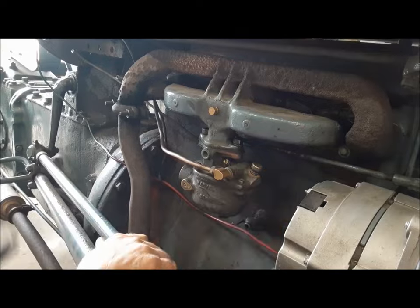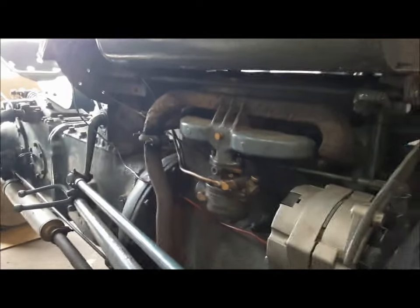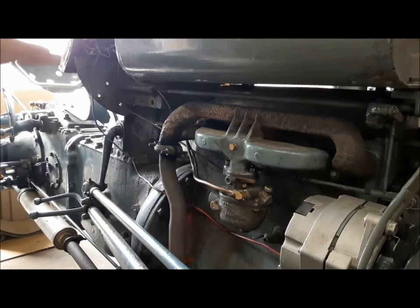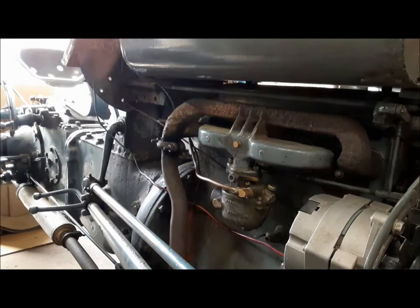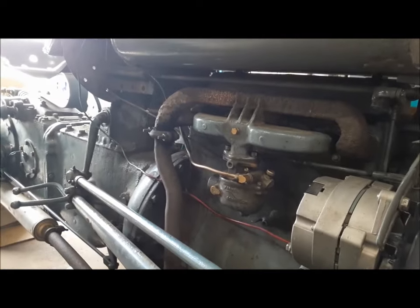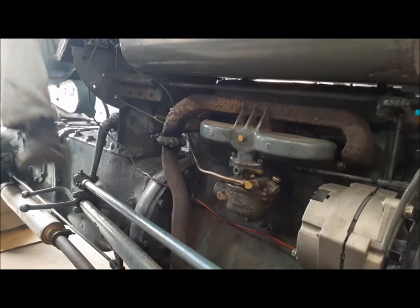One and a quarter — we'll put it there. Now let's see if we can get this thing cranked back up. Even if we do have this running a little bit better now, the combustion chambers and the spark plugs are so fouled up with carbon and fuel it might take a little bit to clear out — or there's still something else wrong with it.